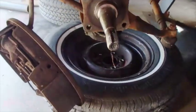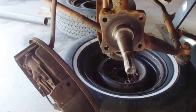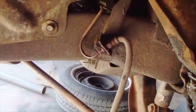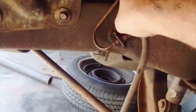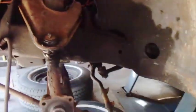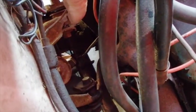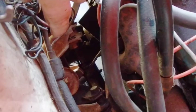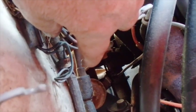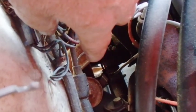I was all done for the day, but I thought I'd just come over and see how difficult it is to get this side done. It didn't take hardly any time at all. This brake line is stripped, and probably needs to be replaced anyway. This line runs into a T-junction right back here — the line on the other end goes to the back of the car, and then there's a line that goes right up to here. If I can get that loose, I'll just plug that off, run a new line down there, put a T on it, and run one side to each side. That'd be pretty quick and easy.